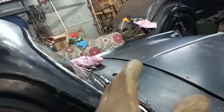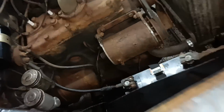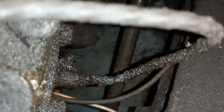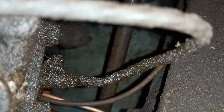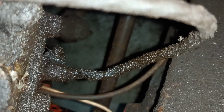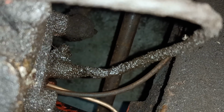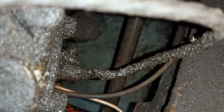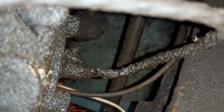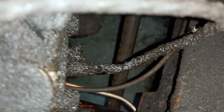I do need to go back underneath and tighten everything up properly. It's only nipped at the moment. And what I need to do for the steering is right down there is like a clamp. It's very oily and dirty and messy, but you see there's like, I don't know, some sort of a nut and a bolt. I've got to undo that clamp and pull the horn rod up enough to get to the steering wheel nut, get the steering wheel off and put it back on.